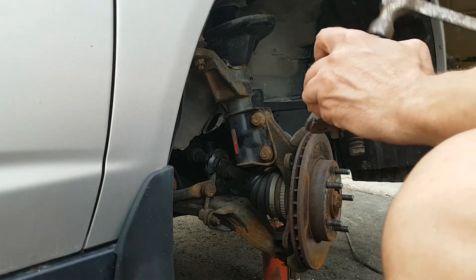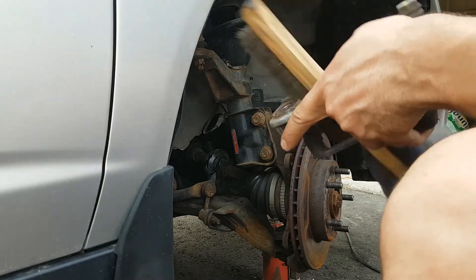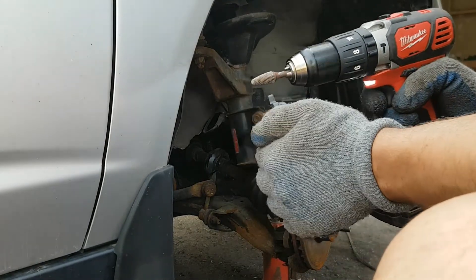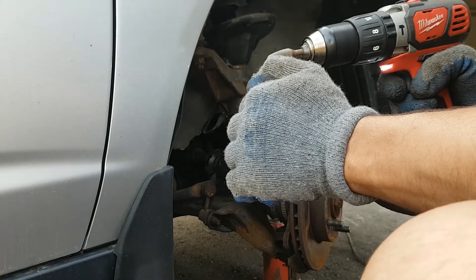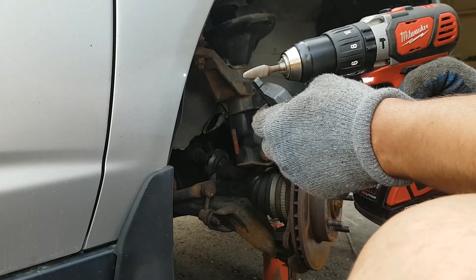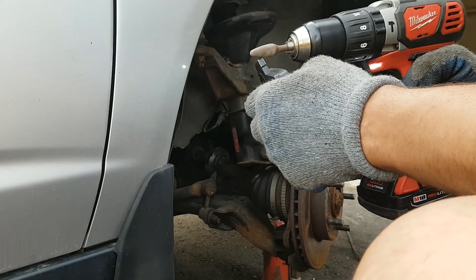Double hit like this — one, two. You want to brush it like this. You always give it a little touch, grind in this pad so it goes free in between. Sometimes it has a sand residue on it, and after you install it becomes very stiff. One side works, the other side not — so you want it to be balanced and leveled, so when you press the brake, both sides work together.